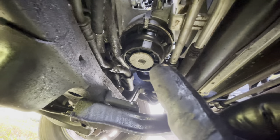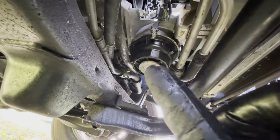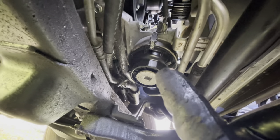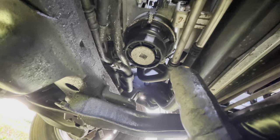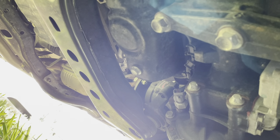This gives you access to the filter right here. It's one of these filters that has an element inside — it doesn't have an outer canister — so you need to get a wrench around it to loosen it, and it's going to drain oil when you do. For draining the oil, that's over here: you don't even need to remove the cover for that. That silver bolt right there is your oil drain bolt. Have a pan ready, loosen it up, and don't drop it in the oil.